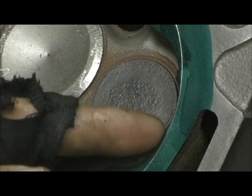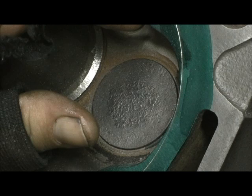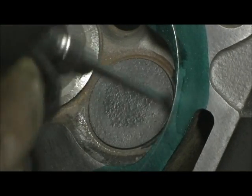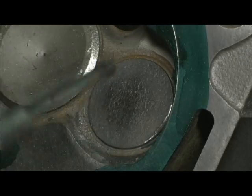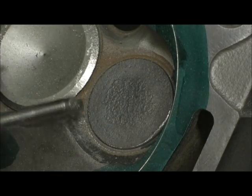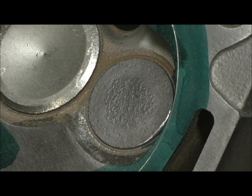That is so true in everything, especially in the combustion chamber area. Because if you have recesses and ridges up in here, when that valve starts to lift off the seat you're already setting into motion a big storm — like a tornado of eddy currents. Now I'm going in with the big ball, and I'm going to come back with the small one to get a little closer on the inside, then start reshaping. I'm going to pull this backside, open it up, and lay it in right there. This is not to induce swirl — I want to keep this swirl staying straight.